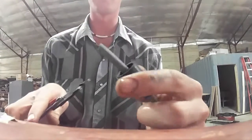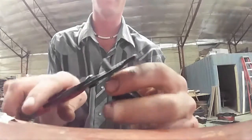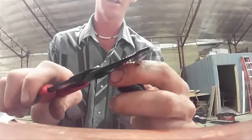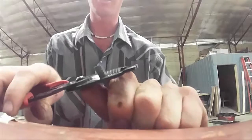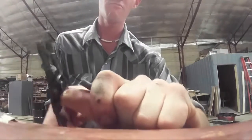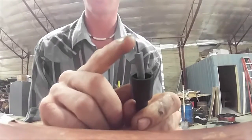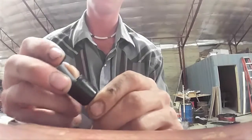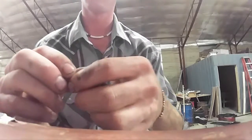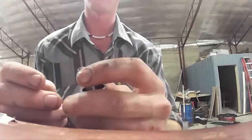Once you've got it on there, just take the strippers and go down about a half inch or so. You just want to be very careful — just strip the outside and pull it off. All that's sticking out is a little diode; that little bugger you just fold over to the back. If it doesn't really want to lay down you can strip more off — doesn't have to.